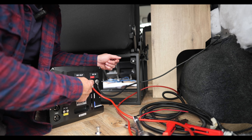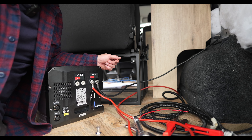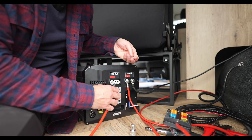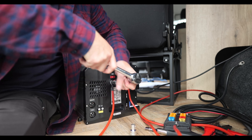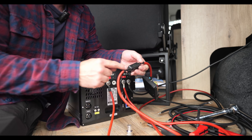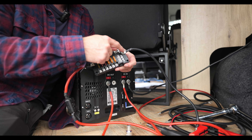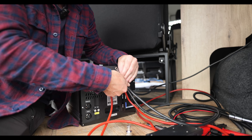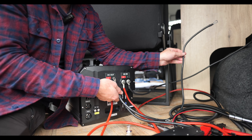For a recap: we've got the positive that runs through to the front of the vehicle and connects to the 60 amp inline fuse, which then connects to the positive on the vehicle battery. We've got the negative which runs out and goes to a common ground. Next, take your positive from your DC-plus — again a washer and a spring-loaded washer. You've got an M8 connector shoe going through to an M4 connector shoe into your fuse, another M4 shoe into your main fuse board, and then another M4 shoe going out to your negative into an M8 shoe. Run another negative also to the ground so you've got the DC-out grounded as well.